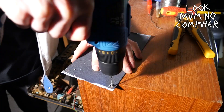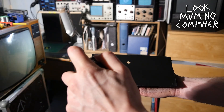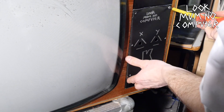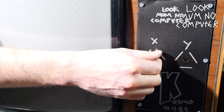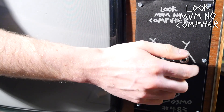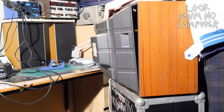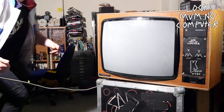Oh, Sam, slow down — you're moving too quick. He's now making a front panel, spraying it and then doing a little doodle. Oh, that's absolutely lovely. He's going to mount the panel on the front of the TV. This panel is used to connect the jack sockets so they're connected to the deflection coils for easy access at the front of the appliance. That's just a case of putting it back together, popping the back on — just like that. Beautiful.